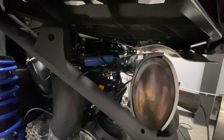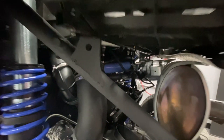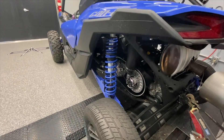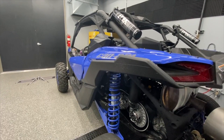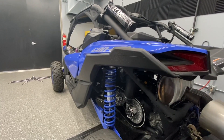We've got a charge tube and blow off valve. Charge tube is worth like 30 horsepower, right? Yeah, I think so. Charge tube, blow off valve. We do have our Shift Tech clutching on there, which we just added today. The power gains are the same, but what we did determine is the acceleration is about a second quicker on the dyno with this clutch calibration than stock.